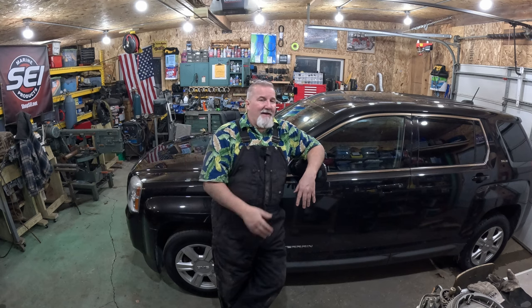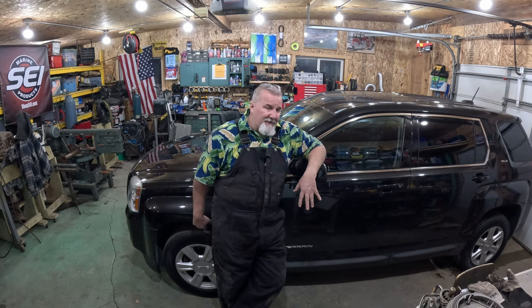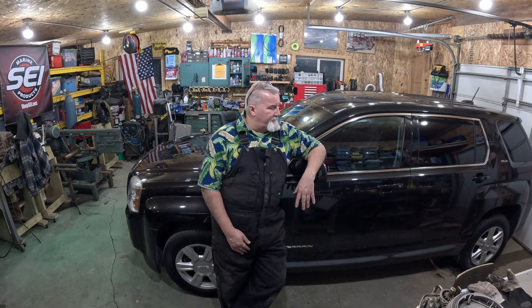When I picked it up, the left front tire had pressure showing, so it must have been on the verge of not working, because it showed it, and the other three were blank on the screen. And then next time I was playing around with it, they were all out. I tried to do the reprogram thing, and the batteries are dead. It wouldn't work. So I've got to order some new valve stems with the battery, the TPMS. Whoa, acronyms. World surrounded with acronyms. But I'm going to order 4 new ones of those, put them in myself, show you how to do it, and show you how to reprogram it, at least on this 2015 GMC Terrain.